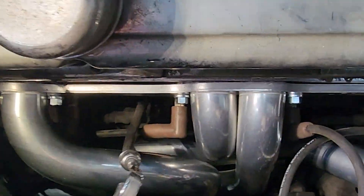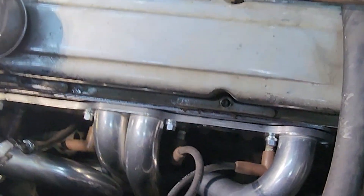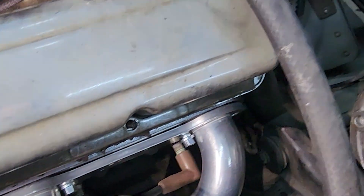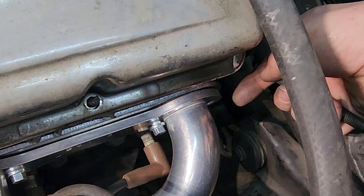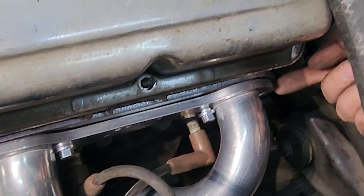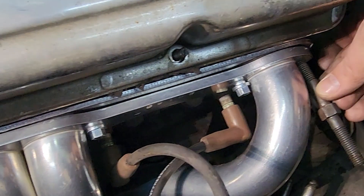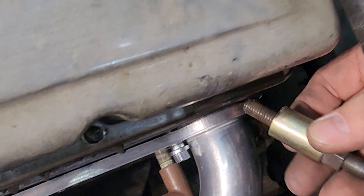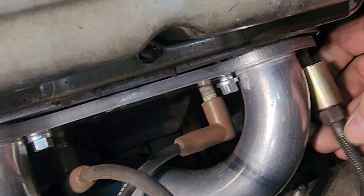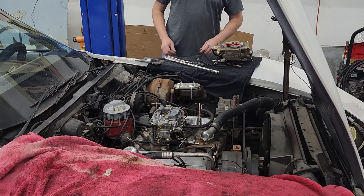For a second I thought we were going to have a problem with the headers fitting around the frame, but as you can see it actually fits pretty good — I just needed to get it into the right position. We do have a slight complication: the air conditioning bracket bolted into the exhaust manifold, which was about an inch and a half thick, but the flange on the header is only 5/16 inch. So we had to make a small spacer — put the spacer on and everything works the way it should.